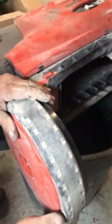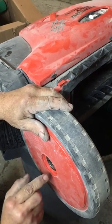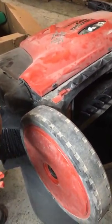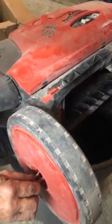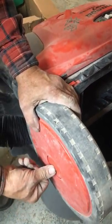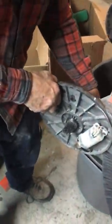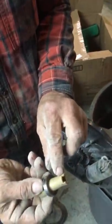Reinstall your wheel with both hands, apply pressure, and walk the wheel back on. The axle shaft should be flush with your bearing. Reinstall your wheel clamp — make sure you haven't lost your spring pin. You want both clamps, one on top and one on the bottom. Never install your clamp sideways — always slide it into the unit and push until you hear a click. The wheel clamp should be recessed inside about 3/32 of an inch. Install your brush holder on the opposite side and install your pinion, remembering your tabs.